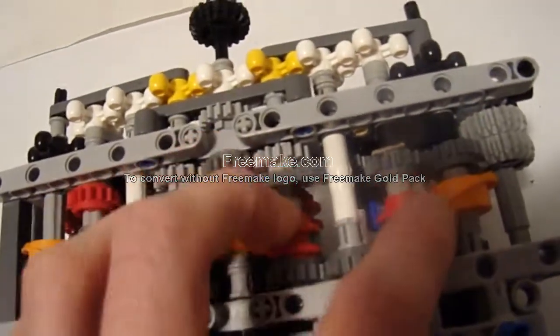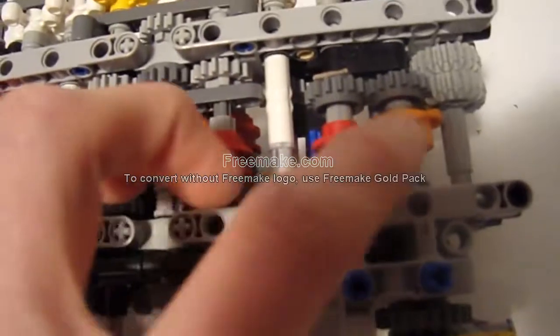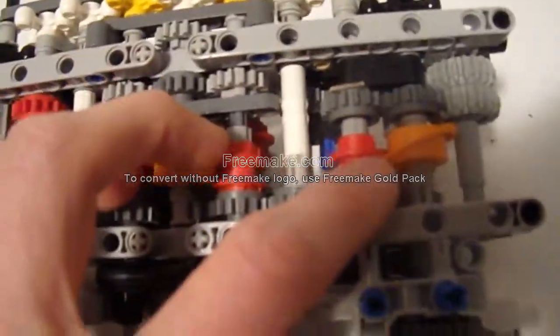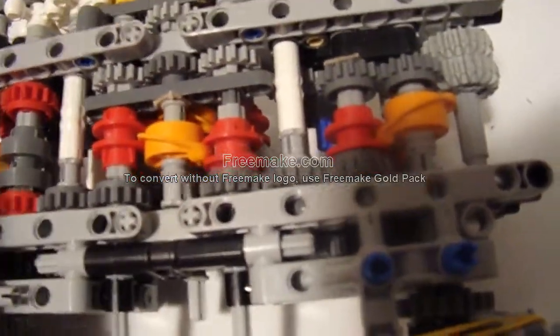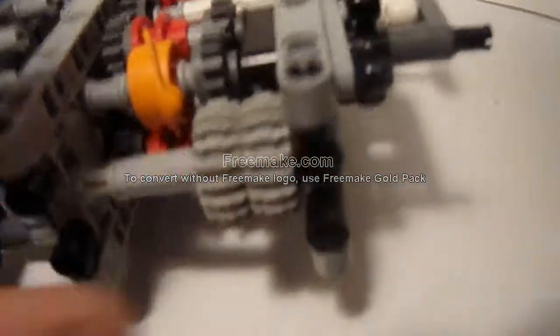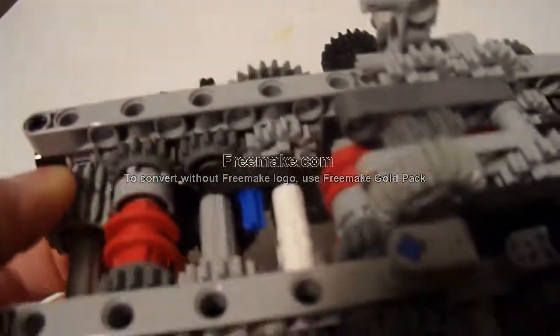The gear progression goes: both clutches on the lowest ratio, then low clutch, high clutch, second lowest, low, high, third lowest, low, high, fastest, low, high. The slowest gear over here is reverse, achieved by using extra idler gears between the two drive gears in order to keep them spinning in the opposite direction.